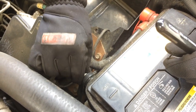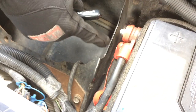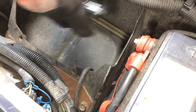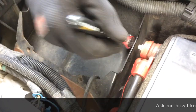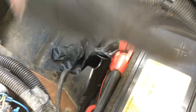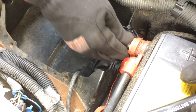You could probably leave the negative on, but I want to make sure it's totally isolated. On these diesels, at least on the Suburban, this is a really bad design — I wish GM had cut a notch out here. This bracket is where on a gasoline engine the engine control module would sit, but it doesn't on the diesel, so it's very close and easy to short out. I like to take a glove or rag to act as an insulator while removing the cable, and when I'm done I can put it on top of the positive terminal to protect it.